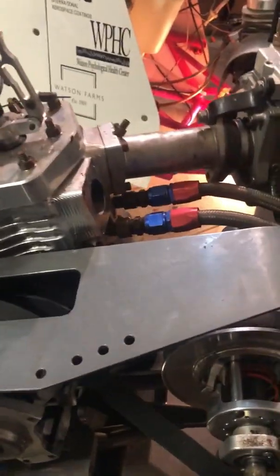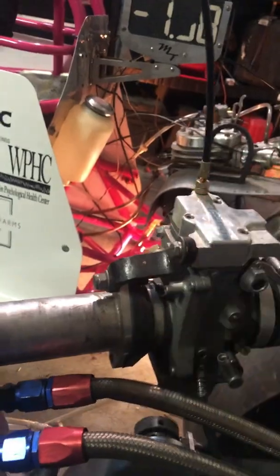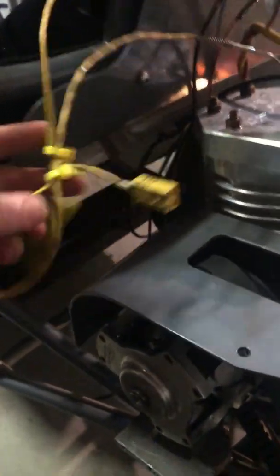Okay, guys, took the exhaust pipe off. Literally, you got 4 bolts right there. That guy was a little bit of a trick to get to, but I used my good crescent on the Allen and just turned it just like that so that it went well. I did not take any of that off. I just simply disconnected that from the Micron. Left that on there, guys, so you don't even have to take that off. You just pull it off. Comes off real easy. That'll save you some time because a lot of guys think all that stuff needs to come off. Nope, doesn't. Simply just did that.